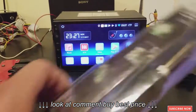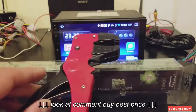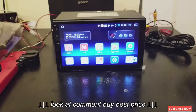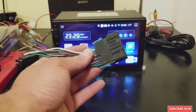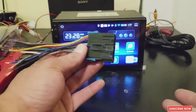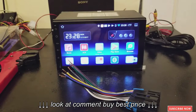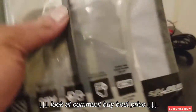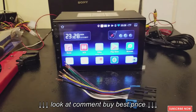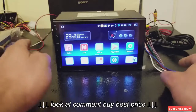All right, so the things that we're gonna be needing are a soldering iron and some cutters. You will need the wire harness for your specific car, so you gotta go by your car's make and model, and then you will buy this wire harness. Another thing that you will need is the double DIN dash for your specific car. In this case, we're going to be installing this radio on a Firebird 2002 that I bought for myself this year, and we need a double DIN so we can fit this radio on the car.